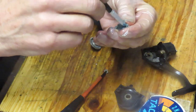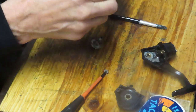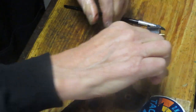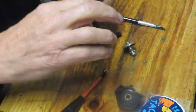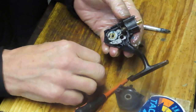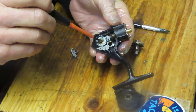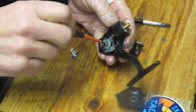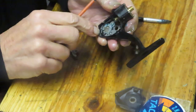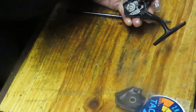I'm going to clean up the crosswind block now — make sure the channel is clear inside, then go ahead and put grease on that as well. I'm going to set this one piece in, though it'll probably fall out when I go up top to work on it again. And I just see right away I should have put the tie-down screw in the oscillation gear, so let's go back and install that. I don't like leaving parts on my bench — they only tend to get bumped around.